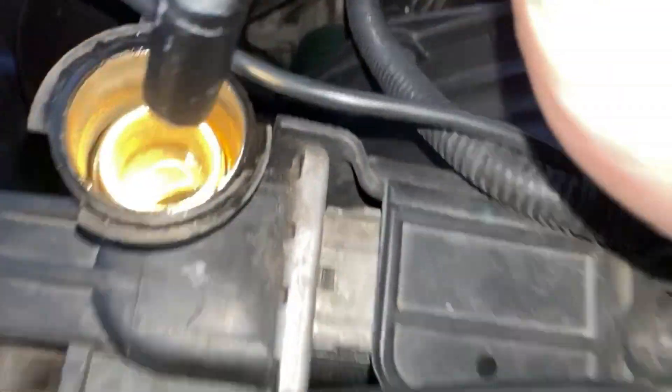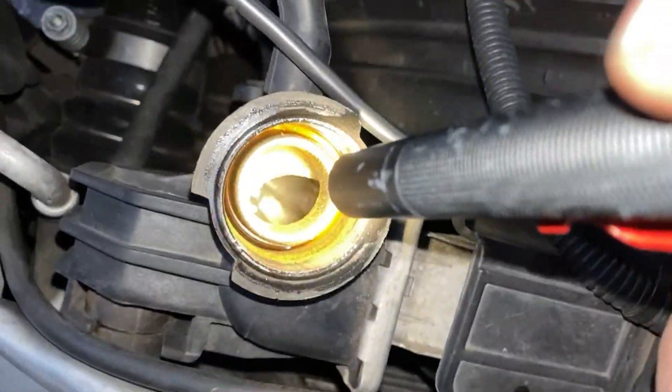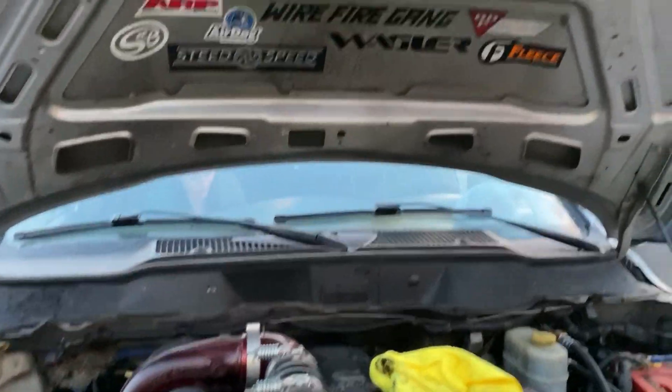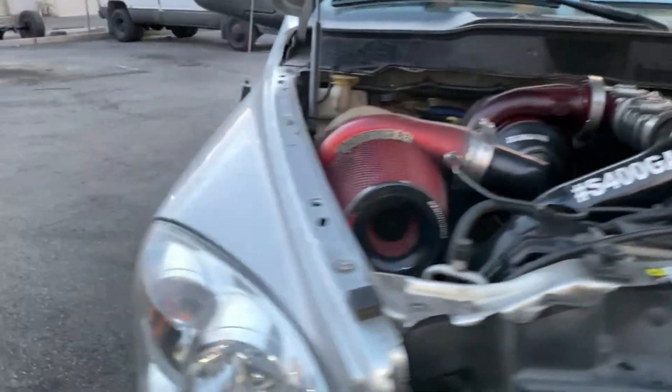After that pull, we went to do another pull. Coolant temp was really high. We saw it had some blow-by. The coolant reservoir is pretty empty. There's some coolant — I'm pretty sure we popped the gasket again. There's stuff here, it's got some blow-by.